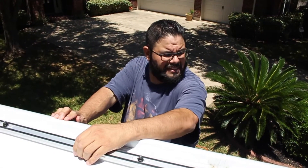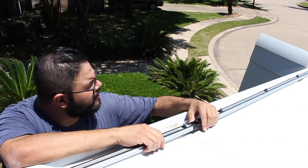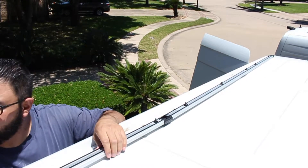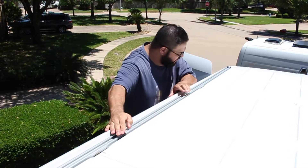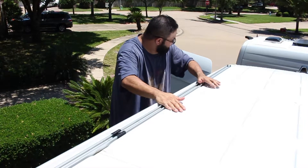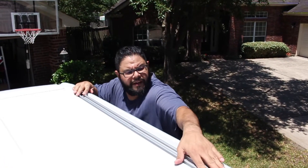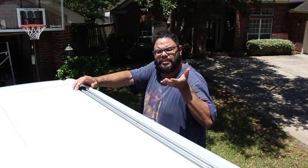The rail comes as two pieces on the 170 — I don't know about the 144. It's got the front piece and the middle section has a little connector with it. I'm going to snap them both together, flip it over, and then go to the bottom to tighten it down. Now I should be able to set them over into the holes. I really like the idea of using the butyl tape — you can feel that it really sits down and has a good seal. Now we'll go to the bottom, put butyl underneath, put some thread locker, put the washer, and tighten it up.